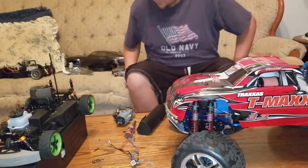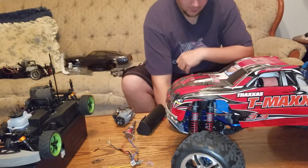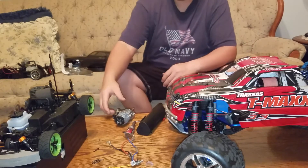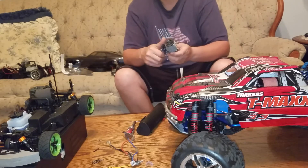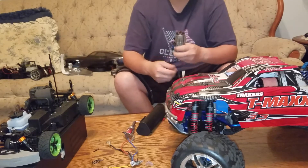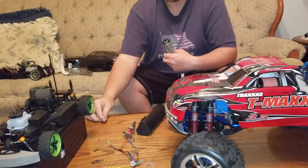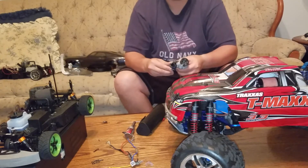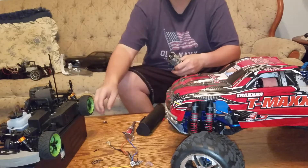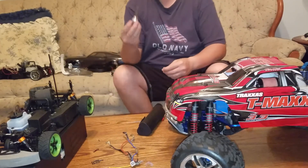In this video I'm going to go over the methods of starting a nitro engine. The very first nitro engines were started simply by spinning them. They work off compression and a glow plug. A glow plug has a filament inside that gets red hot — similar to a light bulb — but it stays red hot from the combustion cycle, not continuously from electricity.